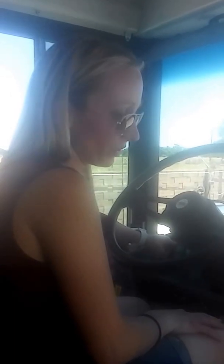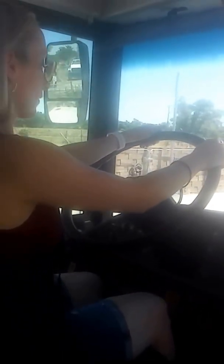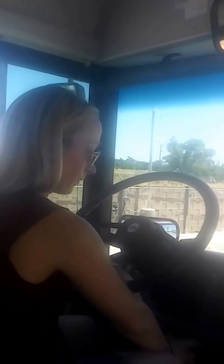Okay, so air is almost done draining. I can hear just a little bit more. All right, it's done now. Drive, releasing, 4. And I heard the air expelling out of the spring brake chamber. Yes. My parking brake, neutral. So I knew that all 4 brakes were applied to stop this bus because the air was expelling out of my spring brake chamber. Okay. Makes sense.